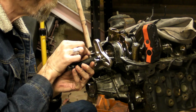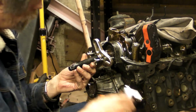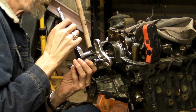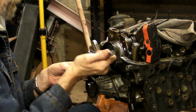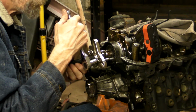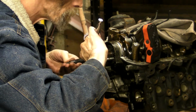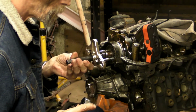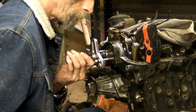So, another set of bolts, another set of hardened steel washers, and we're going to try this again. Draw those bolts down to where they're in equal lengths. Run the center part of your puller in, and as it starts to get tight, you'll be able to see whether it's flat across the face or not, and you can tighten your bolts or loosen them to get them in equally. So you've got it as flat as possible so that it's generating the same force on each side of that gear.